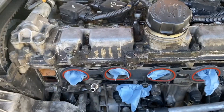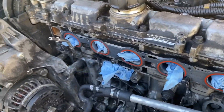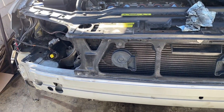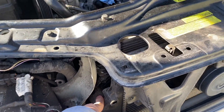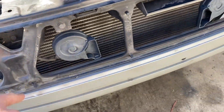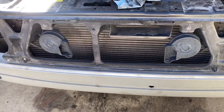What I want to do right now is get the inlet manifold back on along with all the PCV and everything. One way to make it a lot easier is to take the radiator and intercooler off. Something dawned on me — the intercooler to throttle body pipe was absolutely full of oil, meaning from that outlet down I wouldn't be surprised if the intercooler is full of oil as well.